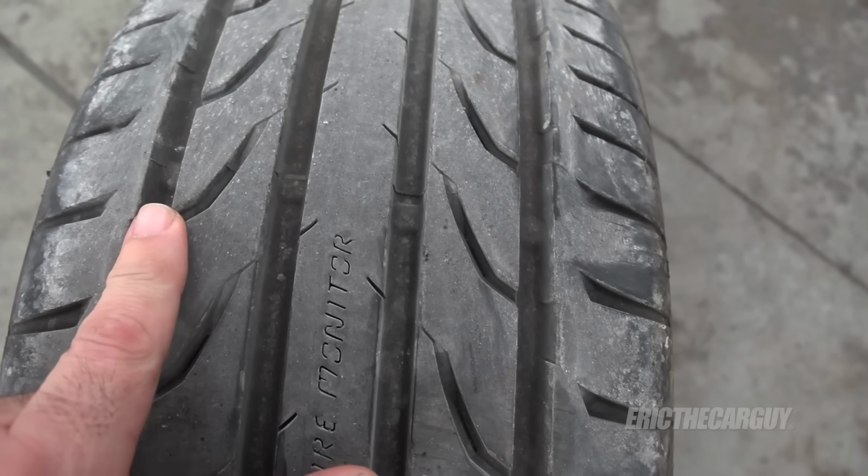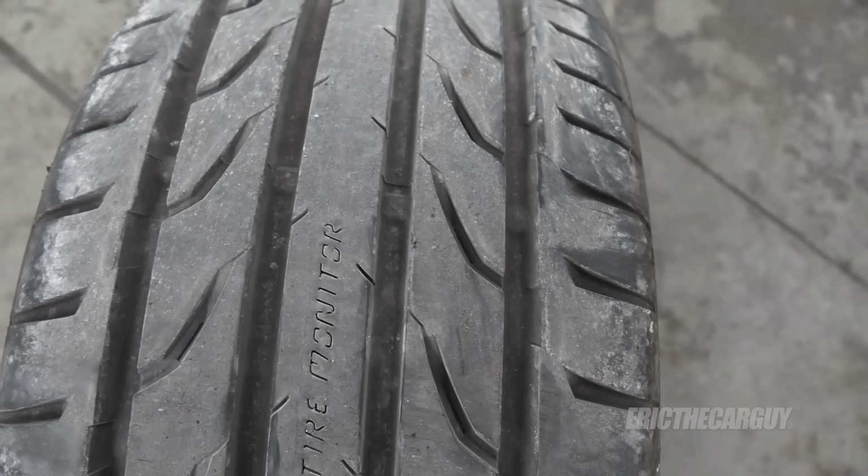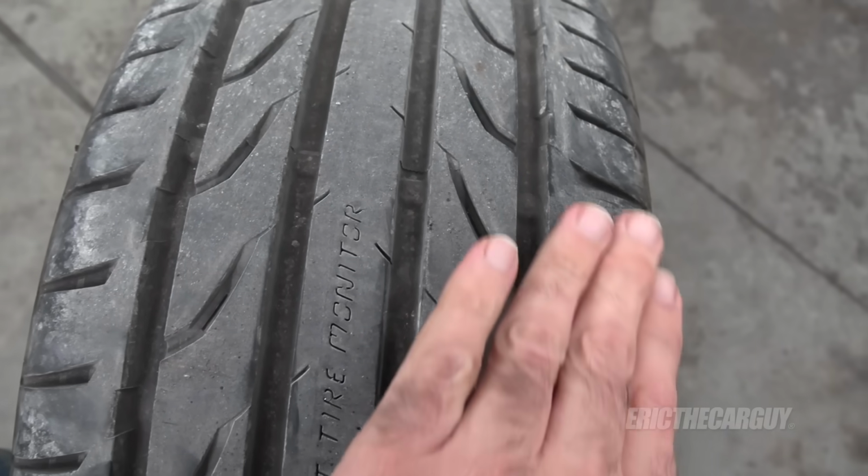Also, anything larger than a 1/4 inch should be off limits. And I should also mention, in some literature that I found, that the area of potential repair is only in this center portion of the tire. They want to make the side blocks here off limits altogether. So there's really a lot of speculation in these instances, and I realize that if you are trying to repair a tire, you're trying to save money and not purchase a new tire, I hope the information in this video is helpful,